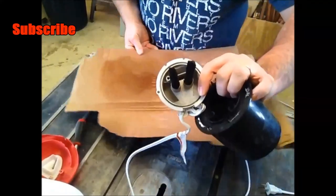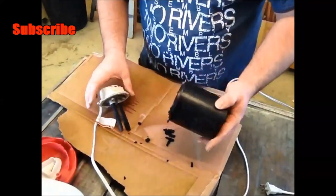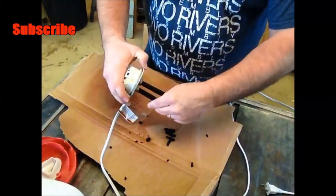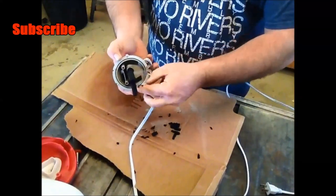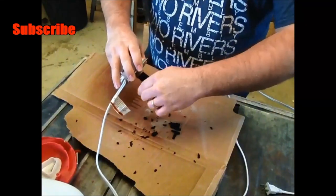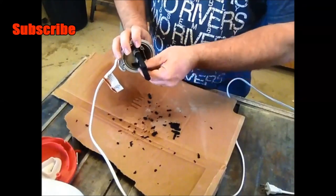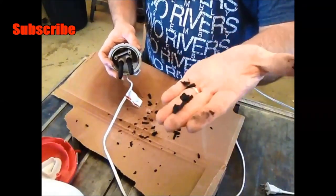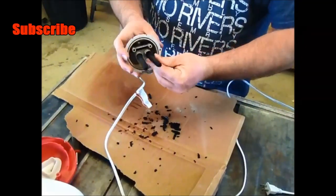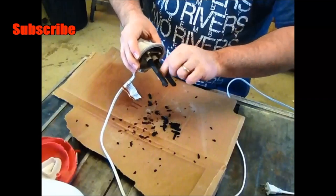You want to be careful with these rods — they are fragile. You don't want to unscrew them if you don't have to. All you have to do is just break this mineral deposit off; you're just going to scratch it off with your fingers. You don't have to take these rods off. What these mineral deposits do is insulate the rods — they keep the rods from conducting electricity one from the other. When it's not conducting electricity it's not heating the water and causing it to steam and vaporize out.